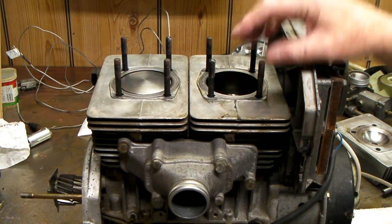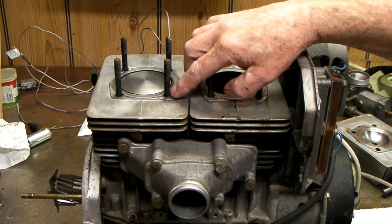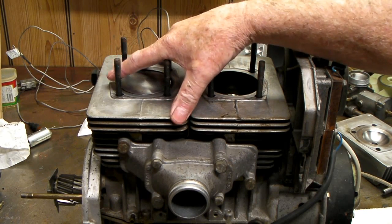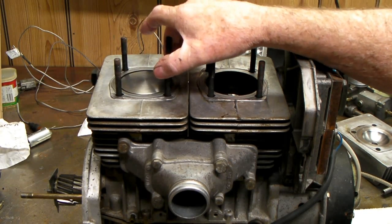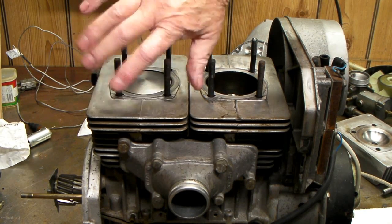Once you get it down, it's really important — with a 447 these cylinders have clearance around the studs that hold everything down. So before I put the heads on and tighten these bolts, I've got to make sure that this cylinder isn't twisted one way or the other.